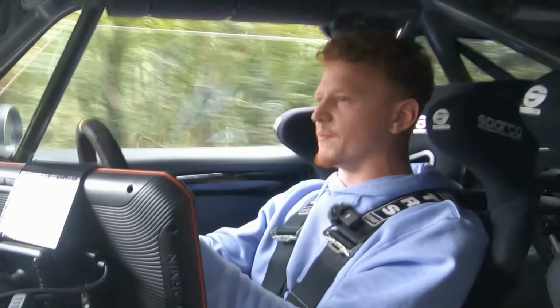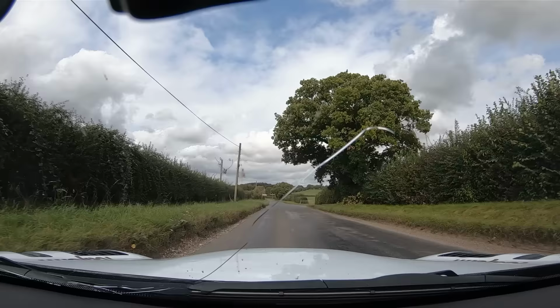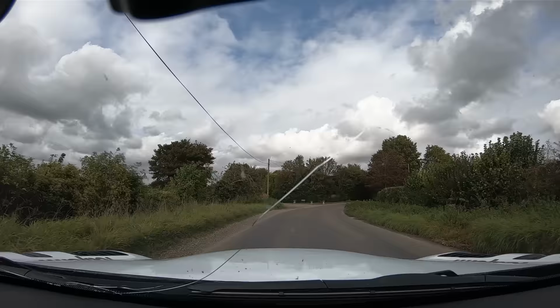Ceramic clutch. Okay. Onto a 3.5 kilo light single mass flywheel. And diff wise as well, we've got a gripper plated diff. It's been recently serviced, in all fairness. No friction modifier, so it is as bitey as it can be, which you can feel. On the tight maneuvering, it just pulls it in. There are no ifs, buts or maybes. It'll just go.